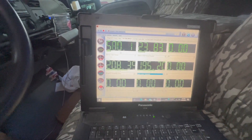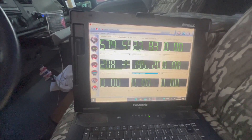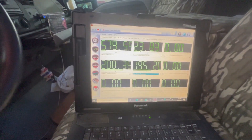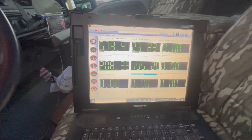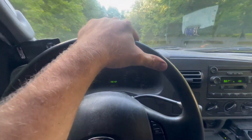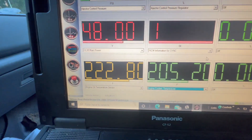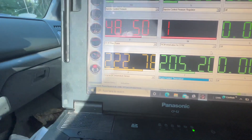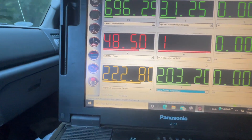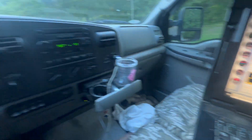Like I've told people, the IPR is a wear item — they're exposed to a lot of heat. That was a Motorcraft when we took it off, so it might be the original one. The screen was stuck in there, it had some trash on it — not a lot, I've seen way worse. It may have just been time for it to go. She is not cut off, I've got her totally up to temp, but look at these oil temps — oil temp is 17 degrees higher than the coolant temp. I'm not happy with that, and he's only had the truck three years.